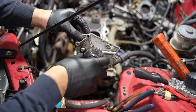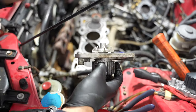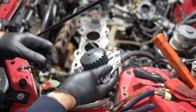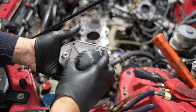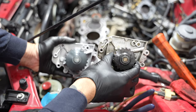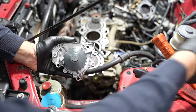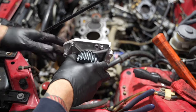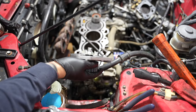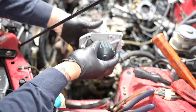So if you're planning on playing along at home, you're going to need to swap out the water pump. This is a 19-tooth water pump and you're going to have to swap it out for a GSR or Integra Type R water pump, which I have here. This one is 22 teeth — you can actually see how big of a difference the pulley size is. The timing belt is going to be different also; you can use a GSR or Integra Type R belt. I just bought a Gates timing belt kit — it came with the water pump, a new tensioner, and a new timing belt. So the length and the teeth are going to be different.